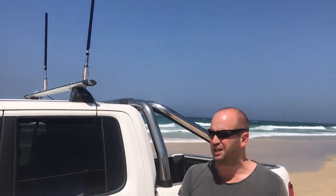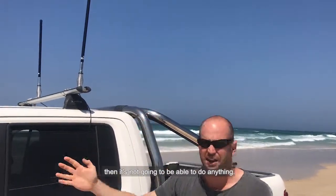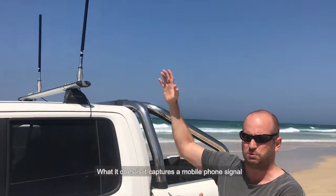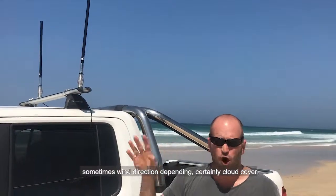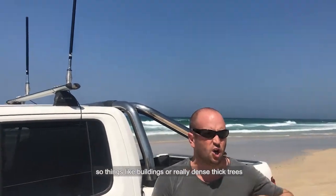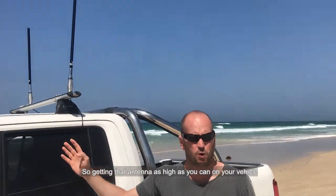It's really important for everyone to understand: this antenna and cradle cannot match a phone signal that's not there. If there's no mobile signal where the antenna is, it's not going to do anything — it doesn't invent a signal. What it does is capture an existing mobile signal from a better location and relay it to your phone via a much bigger antenna. Things that affect your signal include atmospheric conditions, moisture in the atmosphere, wind direction, cloud cover, and human or man-made obstacles like buildings, dense trees, and water, which will also block a mobile signal.